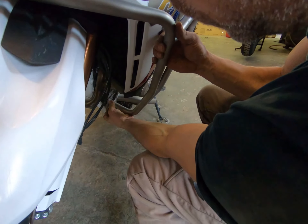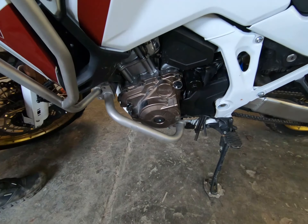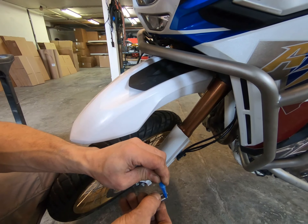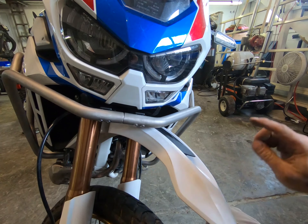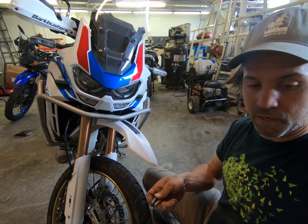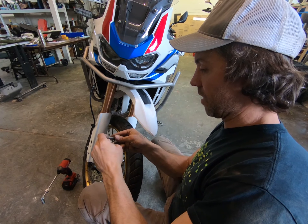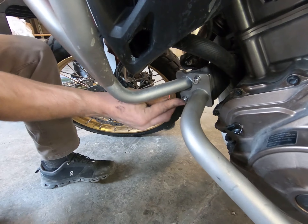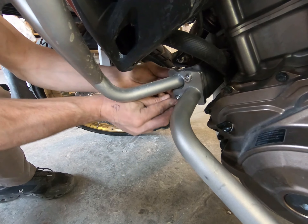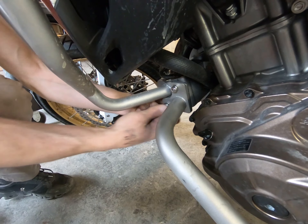I'm going to slide into my gap down here and get my fastener started. I've got my two flat heads — going to get my thread locker in place, get those started. I won't completely tighten these until I get my M6s started. I'll drop a washer on each, do our thread locker again, feed our M6 bolts through, and grab our nuts — these are the serrated locking nuts. Now my universal fronts are all started.